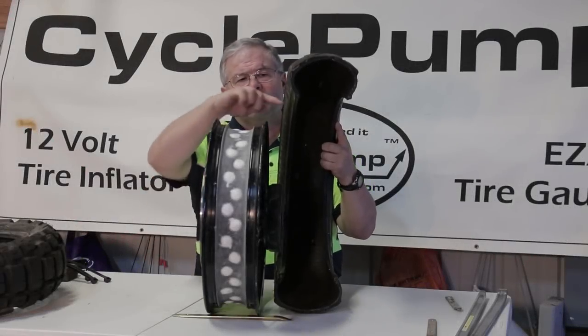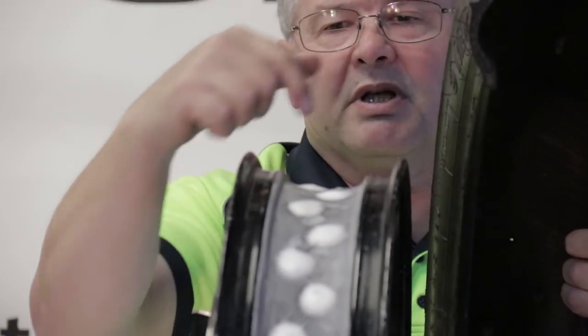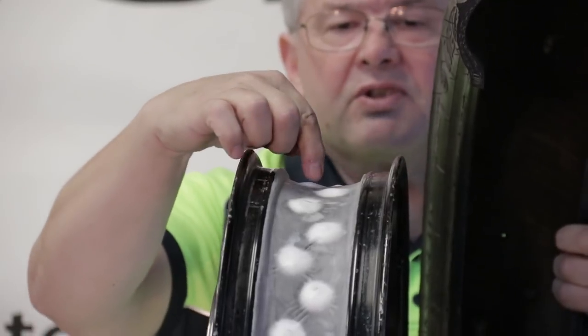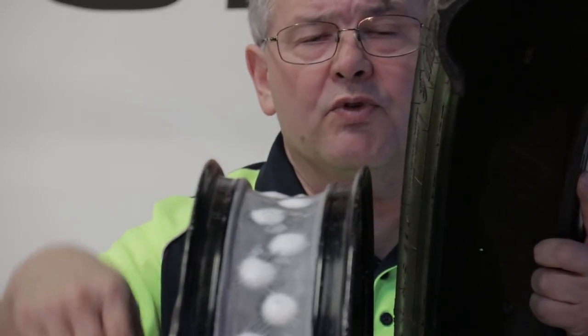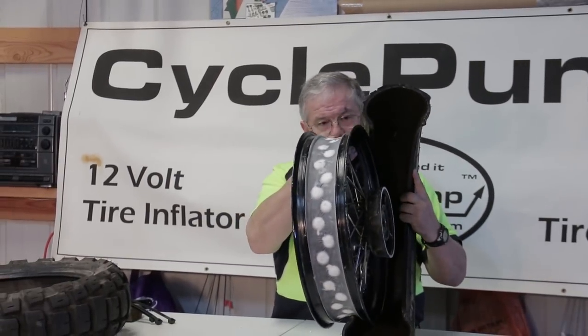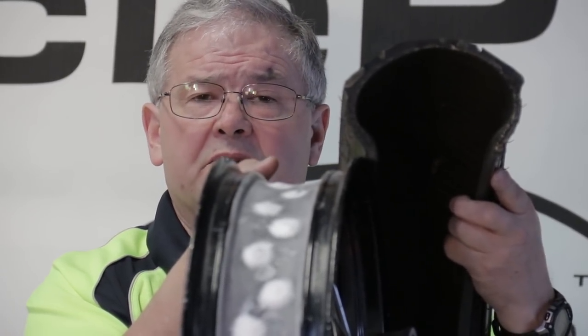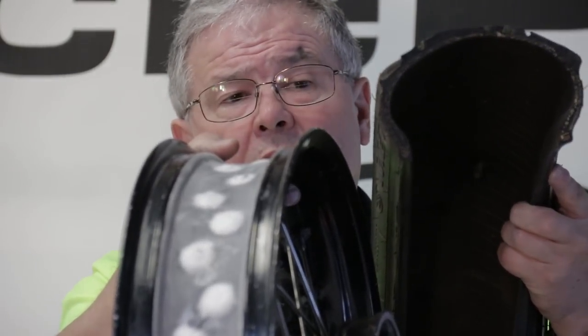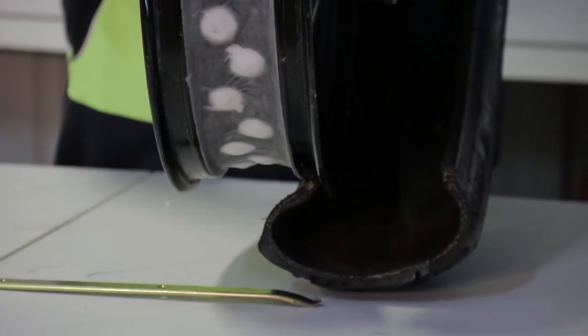Here's a cutaway of a typical tire. Here's the bead and here's my rim. The high edge of the shoulder is where the tire bead sits when it's mounted properly. The well, or concave portion, is where this bead has to be in order to have working room on the other side. If I'm mounting this tire and get it into the well at the bottom, you can see that the tire is almost over the edge of the rim at the top — that's why the first side is usually easy to hump over with just your body weight. If the bead is on the shoulder, I can't clear the bead at the top side; there's three-quarters of an inch of rubber I simply can't stretch to get over that rim.